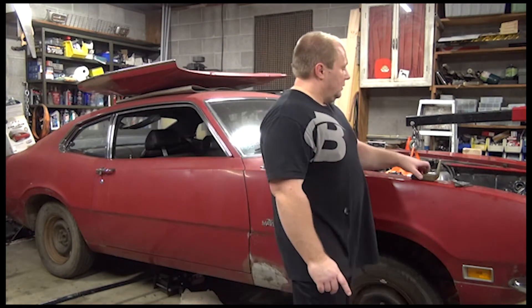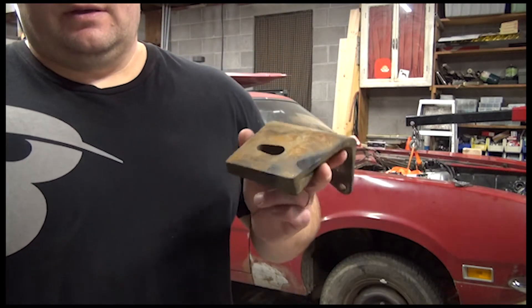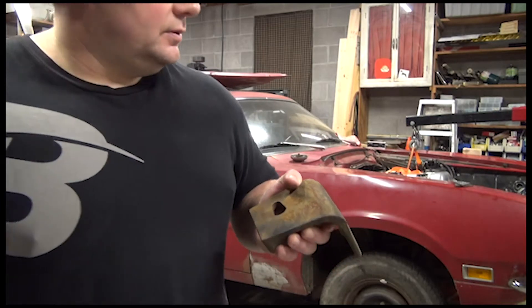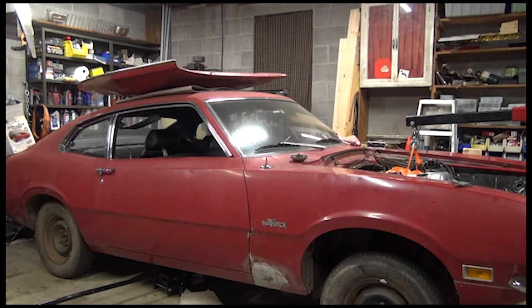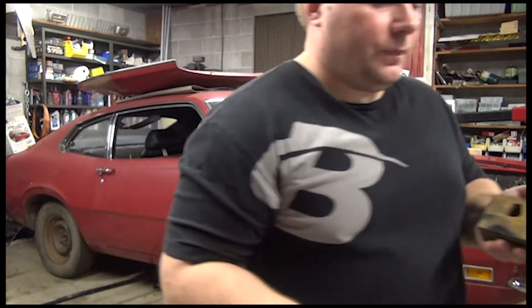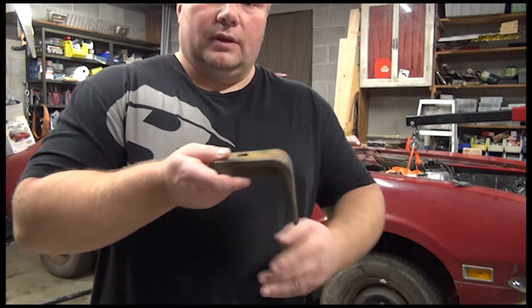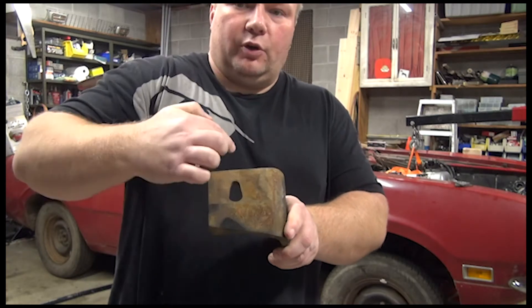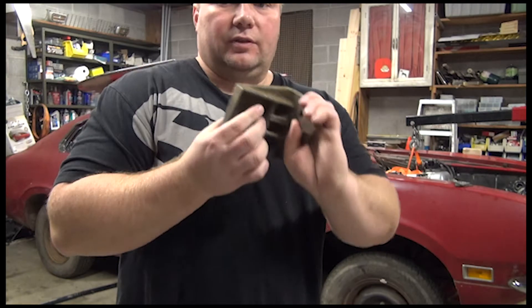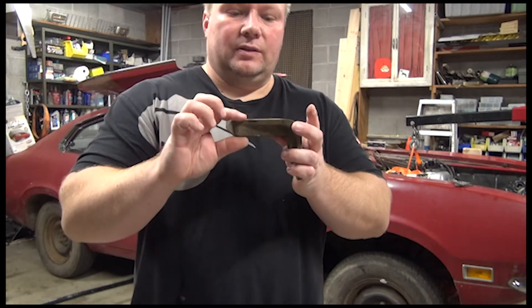In this episode I am going to attempt to make the motor mounts. This is the factory Ford Maverick six-cylinder mount. These are the mounts you need if you put a V8 in a Maverick — it would look like this. This is the six-cylinder. It bolts into the side of the frame with these three bolt holes, and then it goes up over the crossmember. The motor mount slides through this hole and sits, and there's a nut in the back. I tried to use this because the thickness is almost an inch.